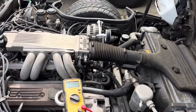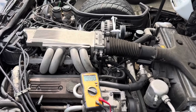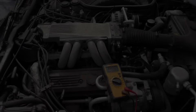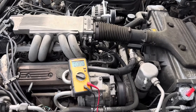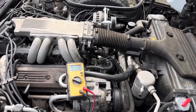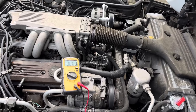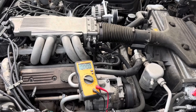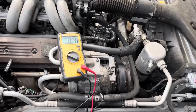If this is not adjusted correctly — if it's adjusted too low — the value on this one should be about 0.54, 0.55, or 0.57, somewhere in that range, and it goes up from there as the throttle moves. If it's at 0.25 or 0.20, way too low, then you'll have a dead spot. You'd give it gas, it would start getting air but wouldn't inject any fuel — it would hesitate and then take off. That's what we were having. If it's adjusted too high, the car idles too high because it's like the throttle is cracked open, so it gives more fuel and takes the idle up.